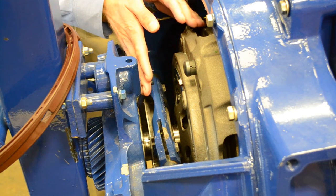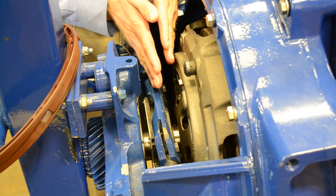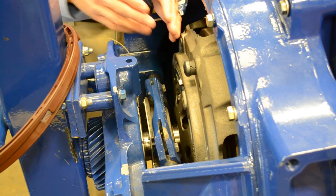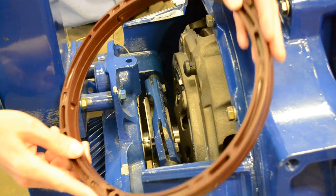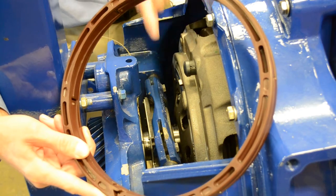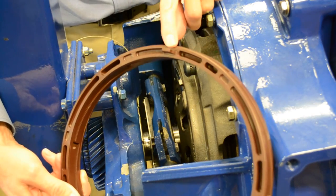Same as the other clutch, as this clutch wears the bearing is going to move closer and closer to the flywheel, or closer to the engine. On the Easy Pedal clutch we had to do an adjustment mechanism. On this particular clutch we have what we call adjusting cams. This is actually the plastic tab you're seeing protruding out of the cover here, this plastic tab right here.